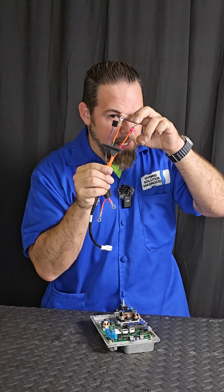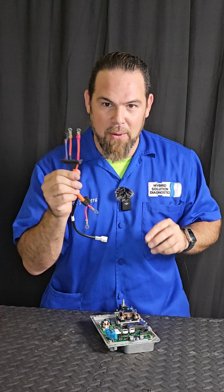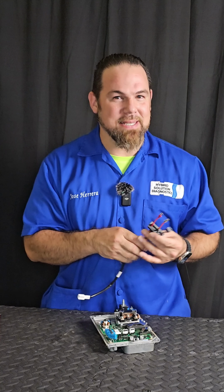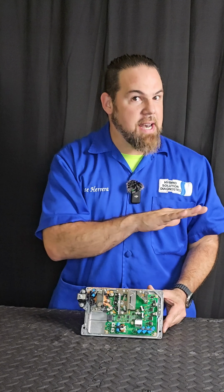So let's say I want to use my hybrid electric car with a powerful sound system. Let me remind you that these two tiny little cables are the ones that receive all the power from the high voltage battery. So yes, think again. Every time you're going to use any type of sound system, always install additional batteries and additional capacitors. Every single hybrid and electric car is no longer using an alternator. They're using a DC to DC converter.